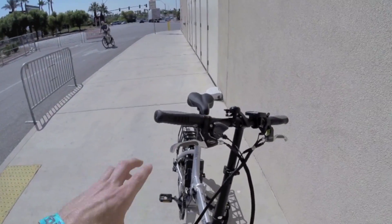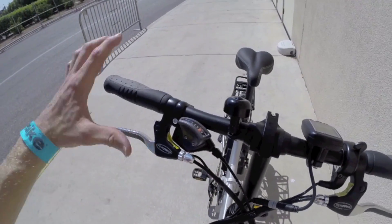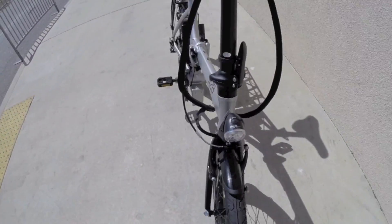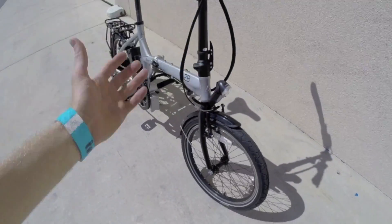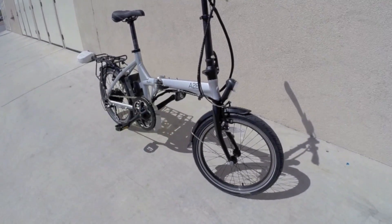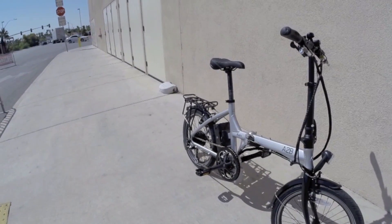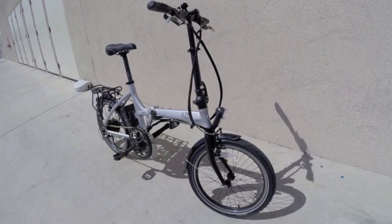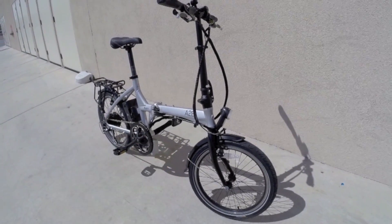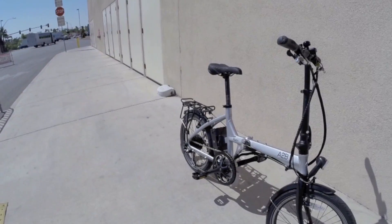The brake levers on this are also sort of upgraded. They're Tektro, and they've got an electronic cutoff, so it kills the motor when you activate them. They pull these standard rim brakes, and that's actually pretty solid for a bike like this that's a little bit more affordable — sub $2,000 for a folding bike. Rim brakes are fine, and mechanical works pretty well. If it's super cold, these are going to be a little easier to fiddle with, and you can get new pads in most bike shops across the country and really the world.